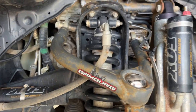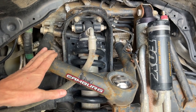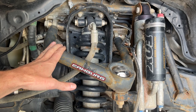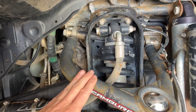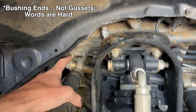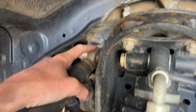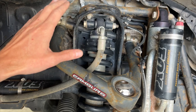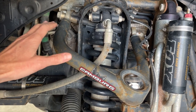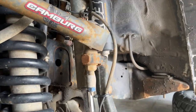Then we jump over to the actual kit that makes this all possible — your upper control arm. This is a five-year-old, third-generation kit. To make it more affordable, they now have a hollow tube upper control arm with gussets instead of heim joints. Heim joints give a little more performance, and they also have a billet upper control arm — the billet now comes with the heim, the tube comes with bushings for a cheaper price point. Either way, it's going to have these big ball joints on top, which are what give the system the ability to hit those crazy angles.